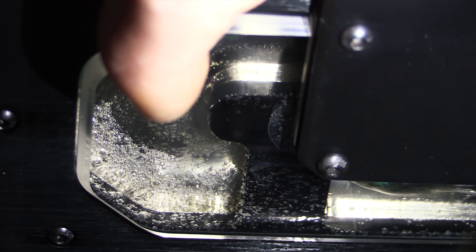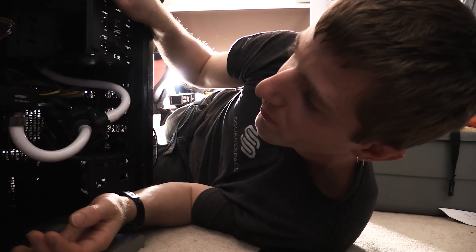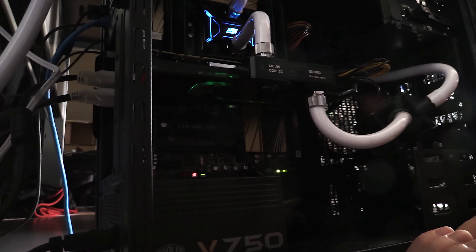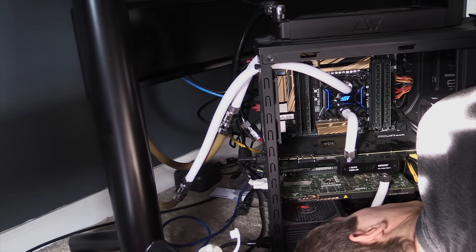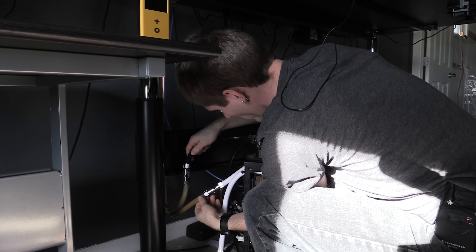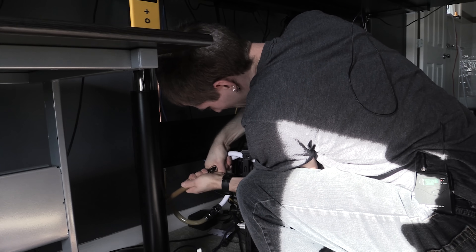See these marks right at the tip of my finger — those are growth. How about down here? Oh, those might be growth too, I didn't see those. Probably bubbles though. That means block performance is definitely affected by the growth in our loop, even on the furthest system from the pumps. But since we haven't seen block performance affected negatively yet, what I'm hoping is we can at least run it until we move. And once we've added some kind of a biocidal agent like iodine to the loop, we should hopefully kill that stuff and inhibit the rest of its growth. So do we have to clean those blocks? The blocks will need to be disassembled for cleaning. What about the rads? Do they have to be replaced? Right now it looks like that would be our best bet. Or we could just irresponsibly not do it — put in a biocidal agent, put an inline filter in, and just kind of go, yep, good enough, and not clean anything. That is another option.